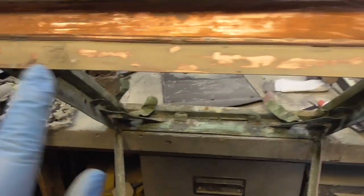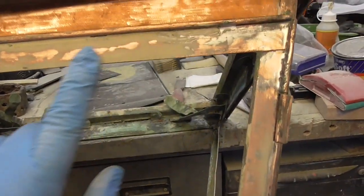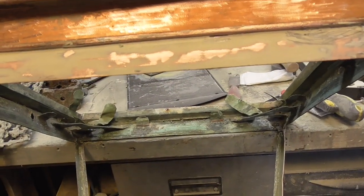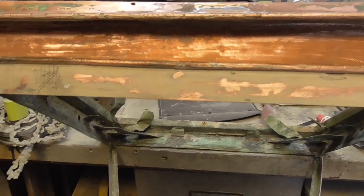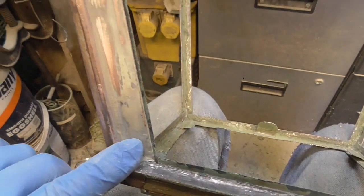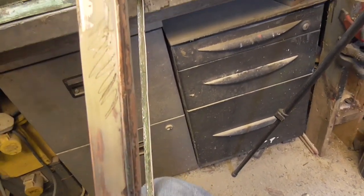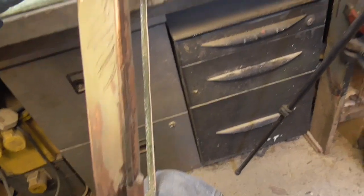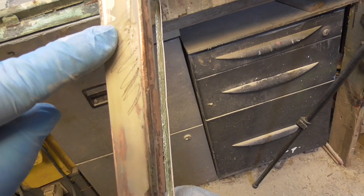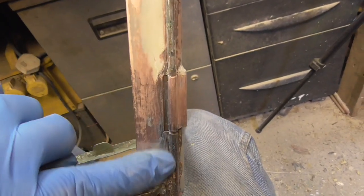And if I bring it around on the door, got a bit of a low spot there and a couple of little bits, but again just roughly till it's smoothish. You can't go super smooth. There's just no way it's going to happen. And again down there, you know, that's the transition, that's the repair panel into about there. And then it just fades out to the original panel.